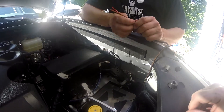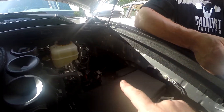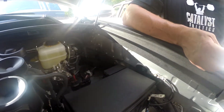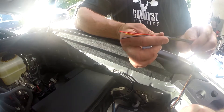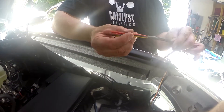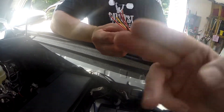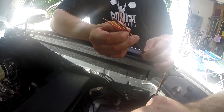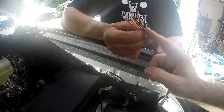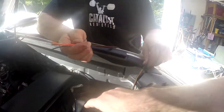A couple of important things: there's a little rubber inside of there that we had to punch through to get the wire through, but it wasn't too hard — pretty easy to get through. However, it was gonna be really hard to get the pre-crimped connectors through there, so we decided to just cut them off, get some new connectors, and re-crimp them. That's a lot easier to go through.